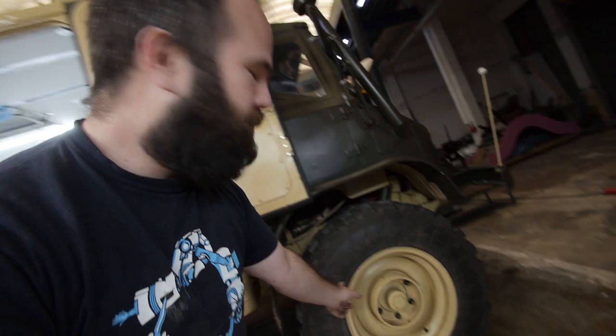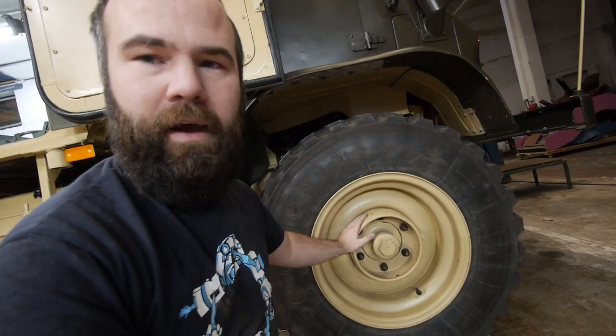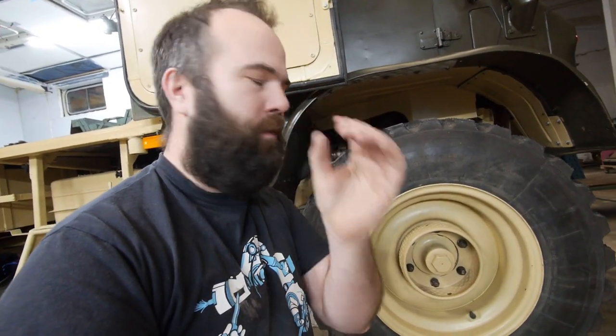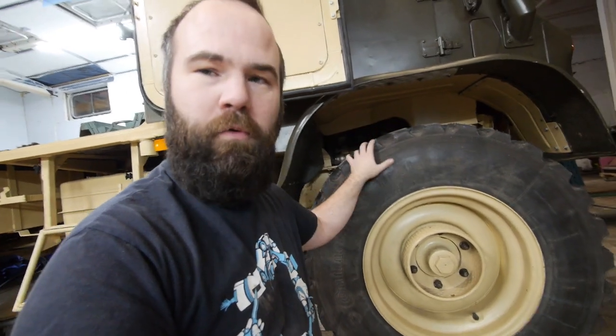That's a big difference. I know my gas pedal needs to be adjusted, but the other thing I think needs adjusting are the brakes — I think they're a little bit too tight. Here I had a little bit of heat, just a tiny bit, probably the brakes were touching slightly. So in today's video I will jack up the front end, test wheel spin, then take off the wheel and inspect the brakes, because they're new and need to be run in.